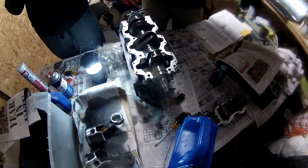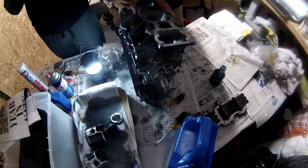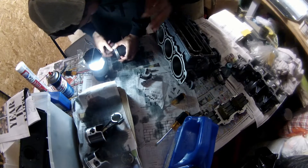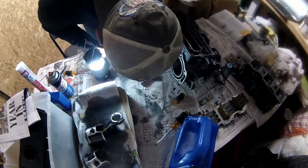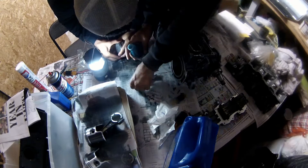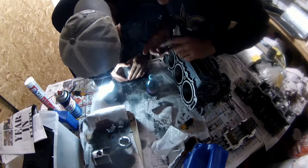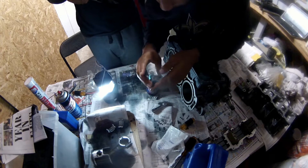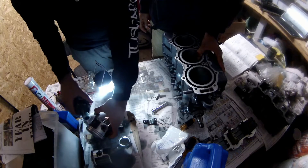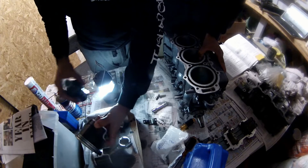We're going to oil them down before we slide them in. Maybe we should set it in here and then it'll lay flat. All right, let's get everything together first — we got our pistons, we need to get our rings out. Three sets of brand new big end bearings, three of those. Let's go ahead and drizzle them up nice and coat them with some oil — coat the big end cap with oil everywhere on the inside surfaces because we're not going to be able to get to them. All right, that's enough — rub it around. Coat the bore in oil, coat your piston in oil.